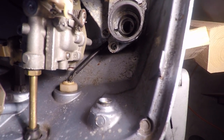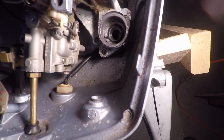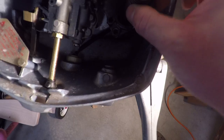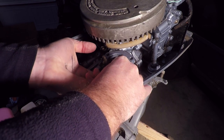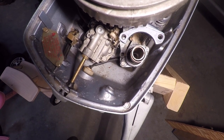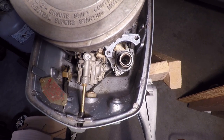That is where the lower spring retainer pin is going to slide into. Once we have it slid into that slot on the left side of the hole, we're going to tighten back up the lower retainer bushing by reinstalling the forward screw and tightening up the rear screw. You can see the tab on the spring that's going to slide down into that slot. Now that we have our spring reinstalled, we can go ahead and reinstall the lower bushing. Inside the spring at the very bottom is also another tab — you'll need to note the orientation of that tab. In this application it looks like it's going left to right on screen, so you'll need to note that orientation.